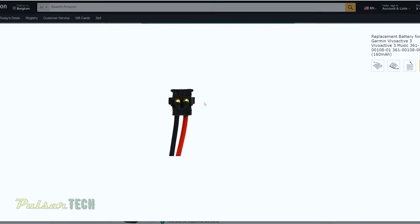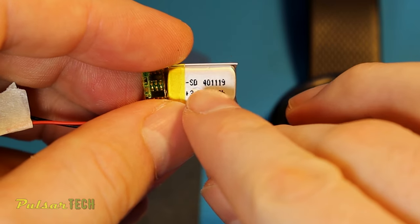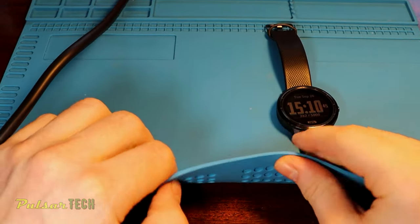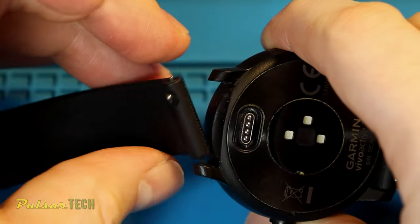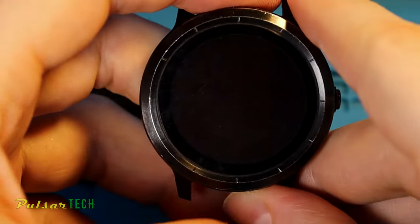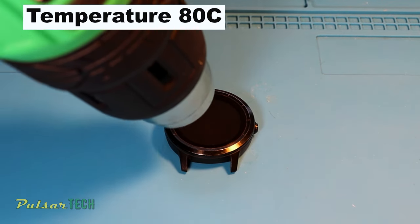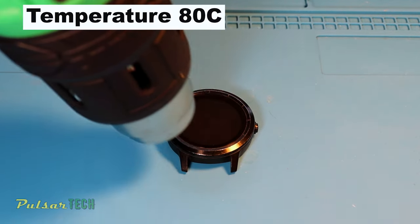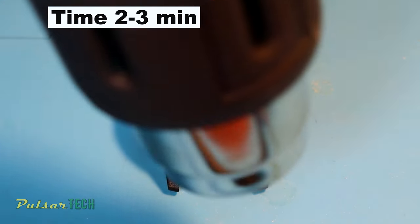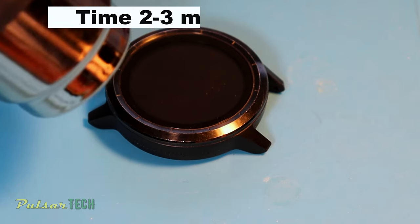This new battery doesn't come equipped with a proper connector for the Garmin watch and only has flying leads, so we will need to cut off the connector from the original battery and solder it to the new battery. I'm also using a silicone repair pad that can withstand high temperatures to somewhat protect your desk. Let's first remove the straps and turn the watch off. I set the temperature of the heat gun and measured it to be around 80 degrees Celsius. You need to move the heat gun around to avoid pointing it in one spot for a prolonged period, as it might cause damage to the display or internal circuit board. Heat it up for 2-3 minutes, depending on the temperature of the heat source — the higher the temperature, the less time needed. But don't go too high.